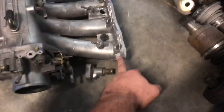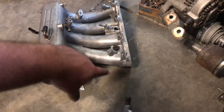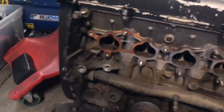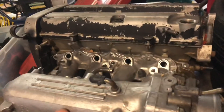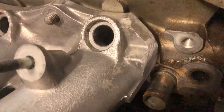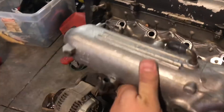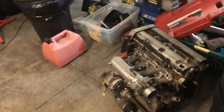I cut off the ear on the side of this intake — as you can see, we still have good clearance on the side for there to be gasket and not leak. I was going to keep a little of this area to drill a hole for a new mount for that bolt, but unfortunately to access the part we needed to cut, we had to make a couple of cuts and couldn't keep that. That's fine — I'll have something welded on there. Just to show you — even with one hand — the manifold sits perfectly on there, still has plenty of clearance from the coolant nipple to the manifold itself. Just needs a little tab there for the gasket, an EGR delete, and that's basically it. The B16 manifold fits perfectly onto the LS/B20 engine.